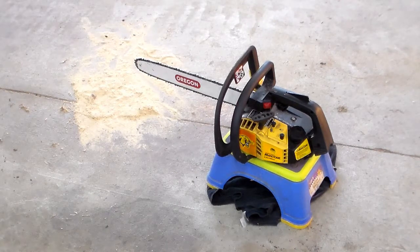It started and it ran — it cut pretty good. It's got a new blade, new bar. The old coil works well, and I actually saved the other one. Maybe I can find a way to replace that wire because that coil is no longer available. I don't know if there's something else that'll work in its place. I also replaced the fuel line and fuel filter since I was in there, and got a new spark plug. All in all, this has been the chainsaw that worked fine until I went to fix one thing on it, then I ended up having to replace everything — but it seems to run really good now and cut really good. Maybe we'll get another 30 years out of it. Thanks for watching.